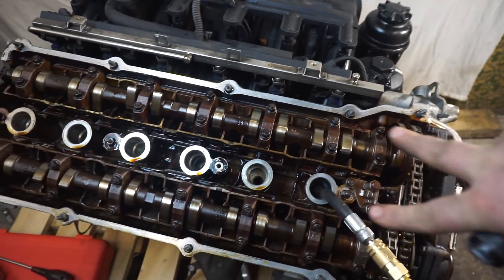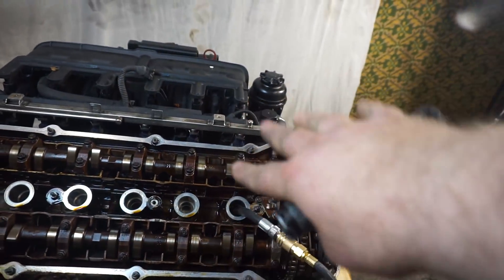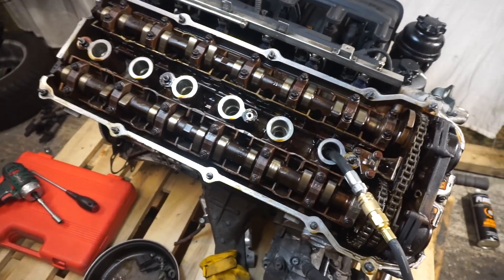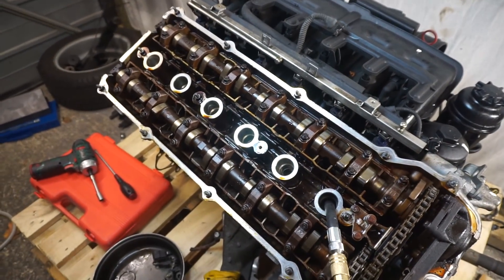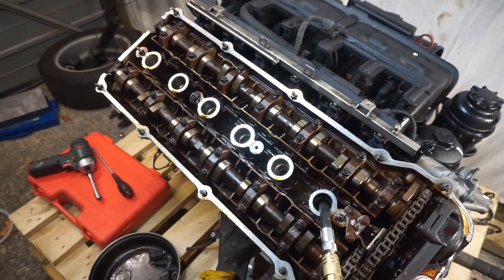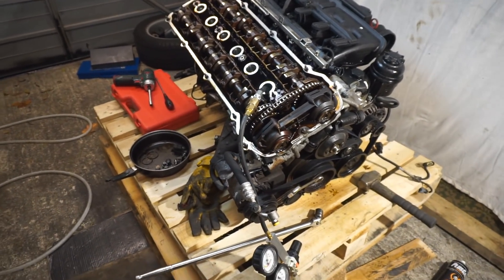What you need to do is go step by step — click, click, click — then a five, ten, twenty degree angle until it's loose. Don't just go straight front to back like I've seen people doing — that's crazy, you're causing warpage and asking for trouble. How to do it is very easy: just read the Bentley manual, it's all there. I will try to do it today and see what I need for this project — should I scrap this engine or not.